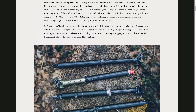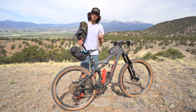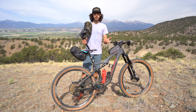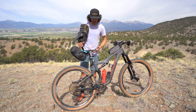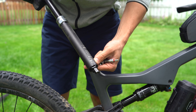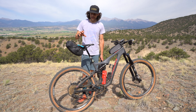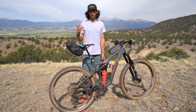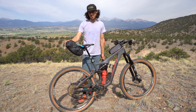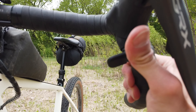There are a few things you need to make note of beyond clearance. The length of dropper that will fit your bike — most new bikes come stocked with dropper posts that fit the insertion length, but when purchasing a dropper for a bike that doesn't have one, the determining factors are the insertion length of the post, the insertion capacity of your frame, and your saddle height. Also, a handful of dropper posts just aren't strong enough to work with a bikepacking bag — they aren't meant for the extra weight, so make sure your dropper has enough power to actually lift the seat pack and saddle up.